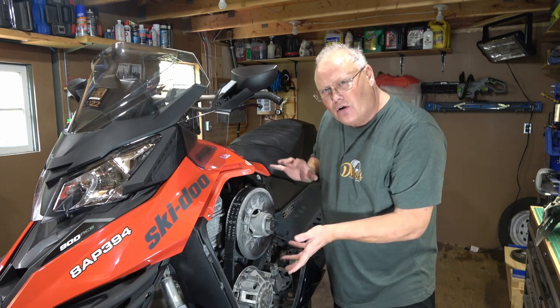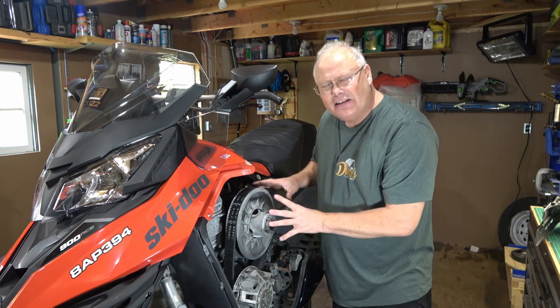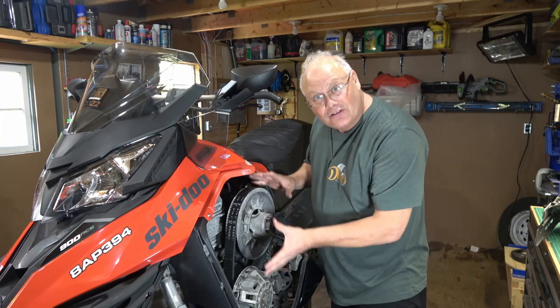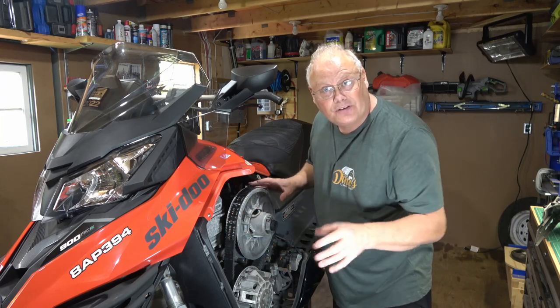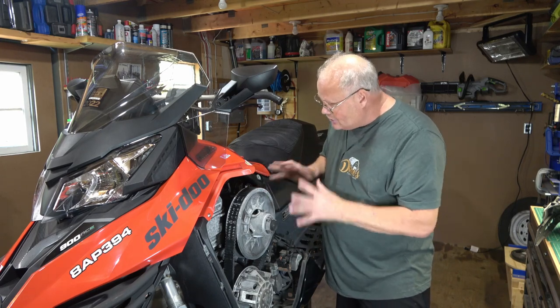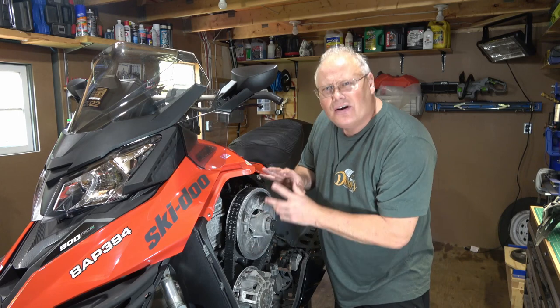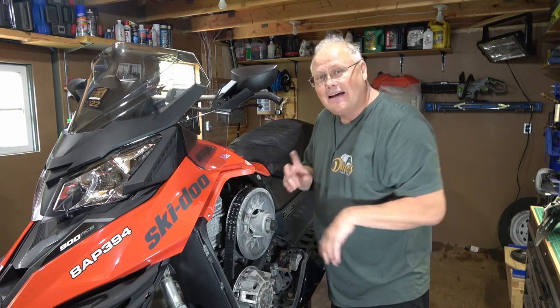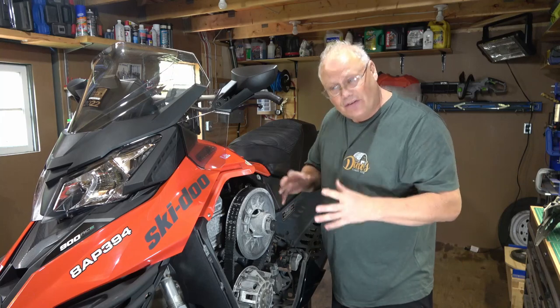I've got a video on servicing the clutch on this particular machine, and I'll include it in the description if you really want to know how to service it and how to set up your belt deflection and whatnot. I'll include that in the link below. But generally, again, you're looking in here for any exhaust leaks, any fluid leaks, anything like that that you may need to add to your list to service.